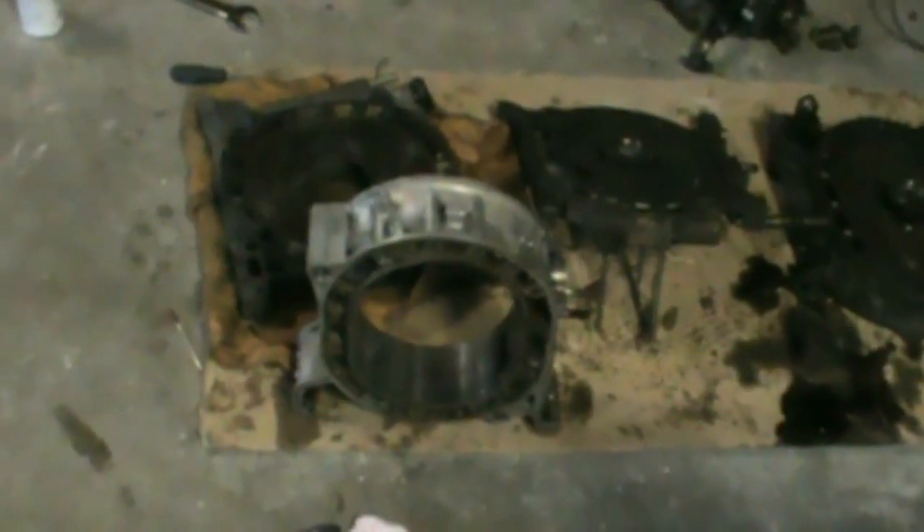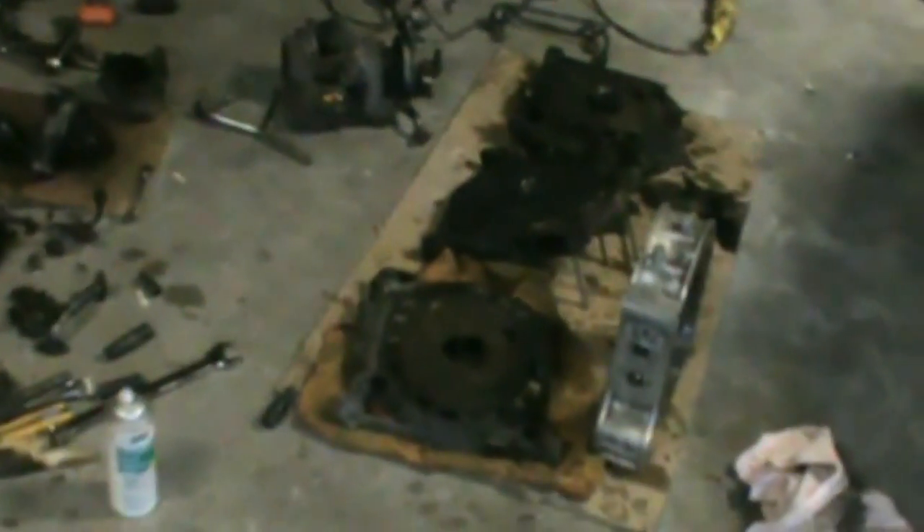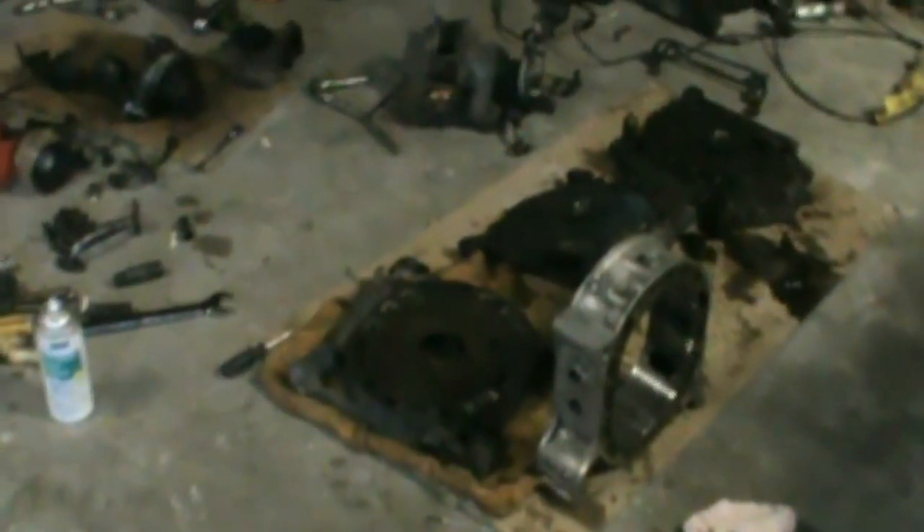Moving on to the rotor housing — this is the one out of the car. You just want to check around and make sure there are no deep gouges anywhere, especially around the spark plug holes and exhaust ports. On the edges you can see a little edge that gets worn down — that's from the corner piece of the apex seal, which is pretty common on a used housing. Just look around the edge and make sure there's no chrome flaking. These ones are pretty good. So I guess over the next day or two I'm going to be getting those turbos put back together and starting all my porting. Anyways that's pretty much it for this video — I'll talk to you guys later.